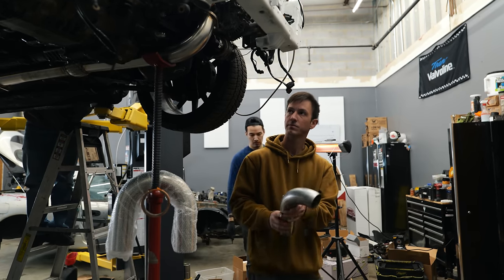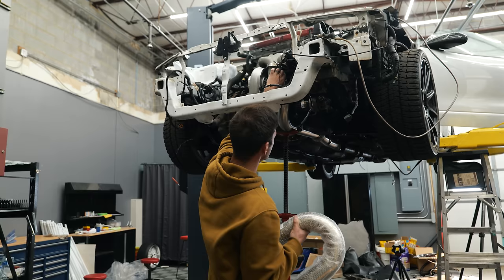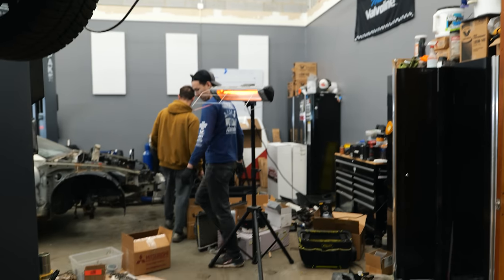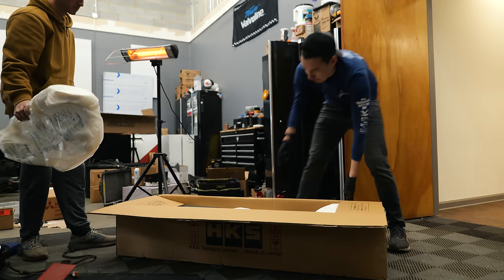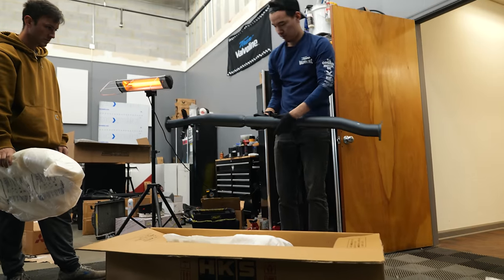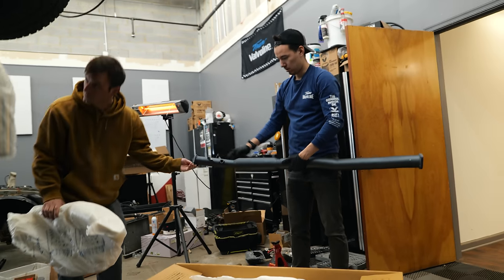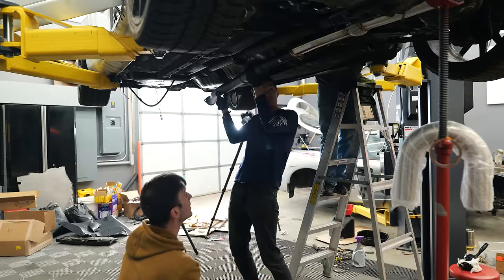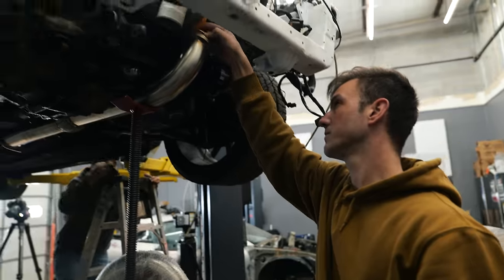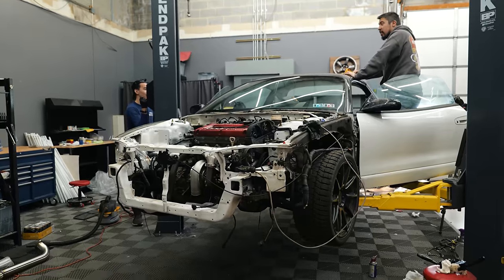Day 9 sees a visit from my extremely talented fabrication buddy Andrew Hicks, who I've coerced into fabricating and assembling my exhaust and charge pipe system. He's here just to see what it is that we're working with. The only 3-inch cat-back I could find necks down to 2.5 inch in order to bolt up to an OEM Talon catalytic converter and downpipe, but for efficiency we want the entire exhaust to be 3 inches in diameter. We mock up the HKS cat-back and STM OEM-style downpipe on the car to see exactly what changes will need to be made, and then I show Andrew the other item I'll need his help with.